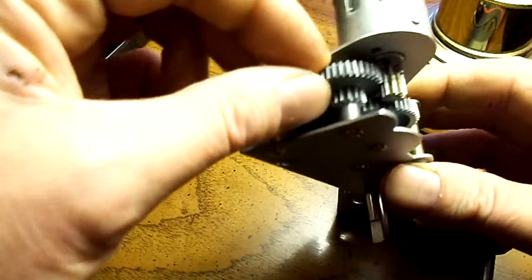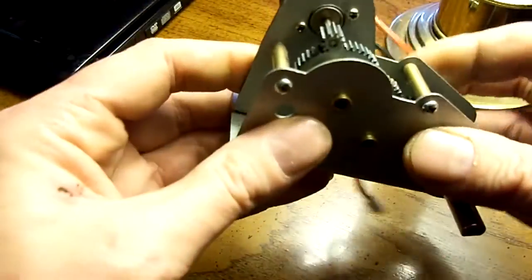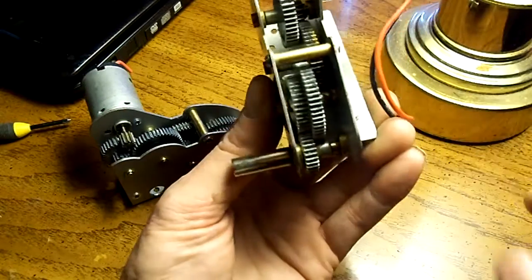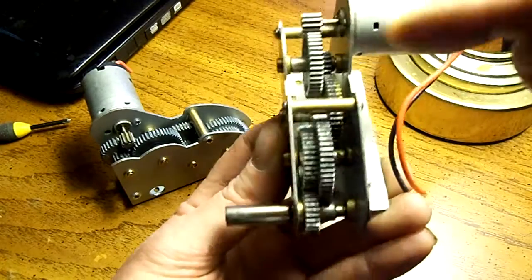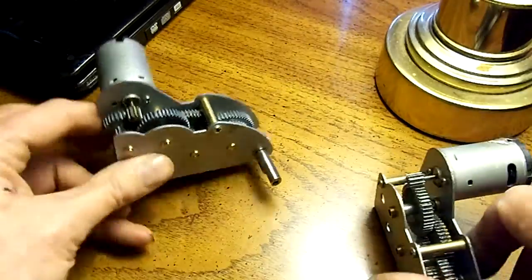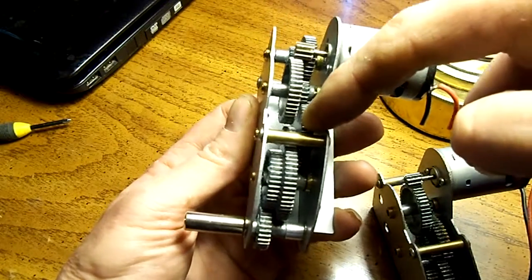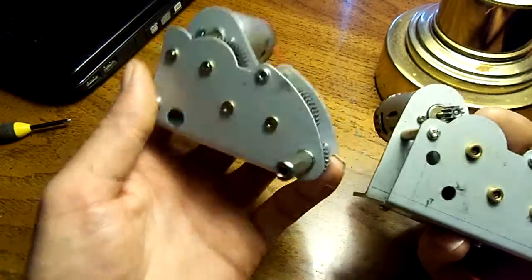On this box there's one, two, three, four bushings. That's because this box has this reduction gear right here - this little shaft at the back is the fourth shaft. If you take this set of gears and put a fourth shaft on there, you'll have a four-shaft gearbox. If you look at it from the top, in between the axle gear and the pinion gear, there are one, two, three gear shafts on the three-shaft box.